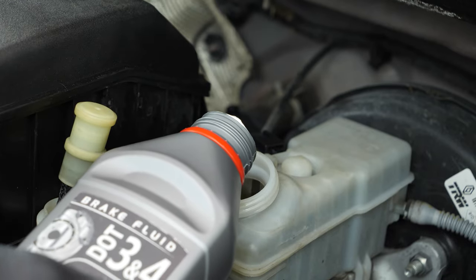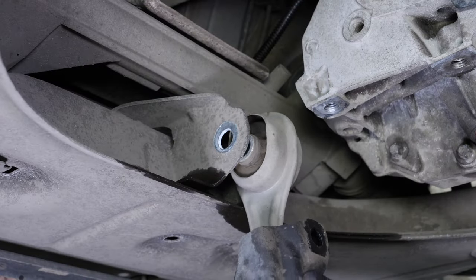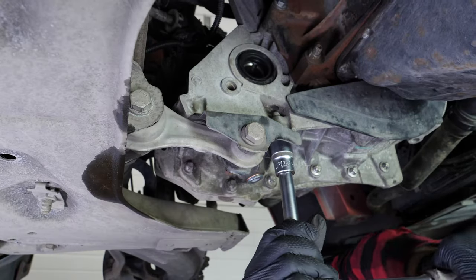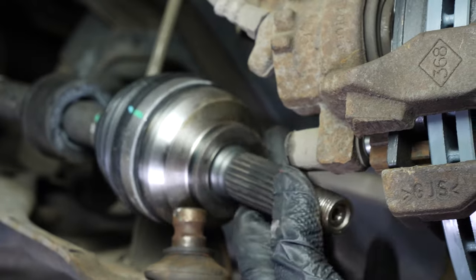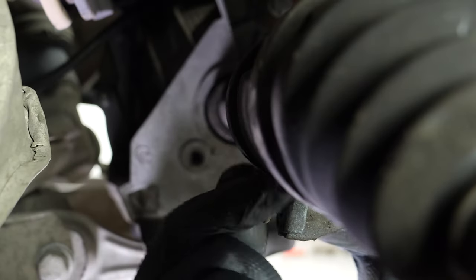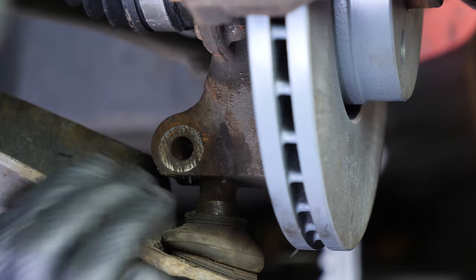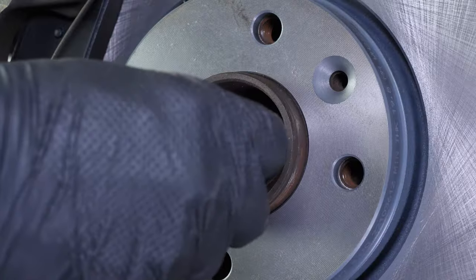Take the opportunity to readjust your brake fluid level. Reinstall the anti-tilt engine mount and screw the three screws back in. Re-embed the driveshaft on the gearbox side, then reinsert the driveshaft into the stub axle. Do the same with the driveshaft on the passenger side — put it back in place and screw the transmission bearing back on. Re-install the control arm ball joints in the stub axles, then screw them back in.